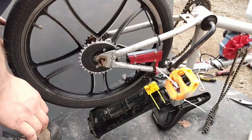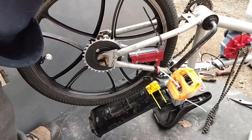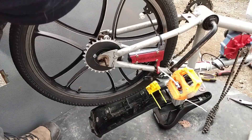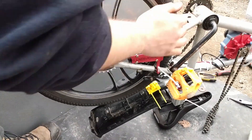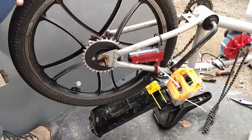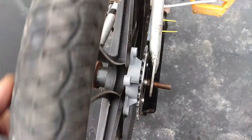Getting the rear wheel mounted with the new sprocket was a little bit of a to-do. I ended up having to put two washers behind the frame plate to space it out a little bit, as well as play around with some other things. I also had to bang the sprocket on the hub to make sure it was square to the wheel — or square enough that it'll work. It's decently tight to the frame, but there should be enough room to just pass a chain through.